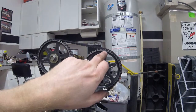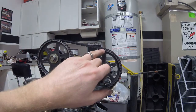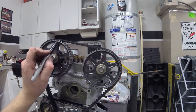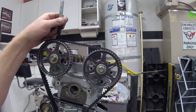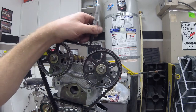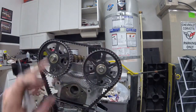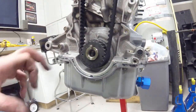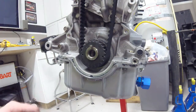To check your tension and make sure it's correct, you'll see the notch on the exhaust cam and the notch on the intake cam. I have little permanent marker marks on each one of these teeth — there should be 19 teeth of the belt between each of these marks. That way you know you have the correct spacing. Count 1 through 19 between the marks to confirm. On the lower portion of the engine, the timing marks on the gear and on the oil pump should be lined up, which means you are at top dead center.